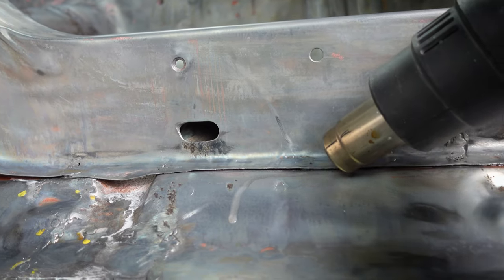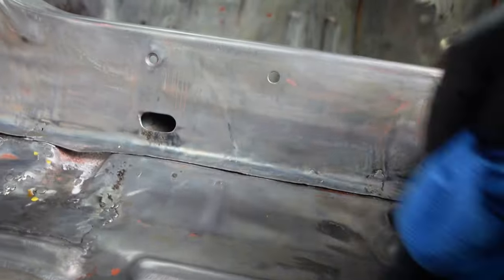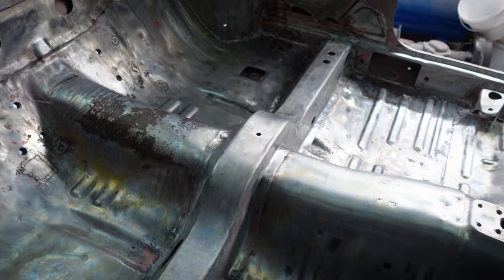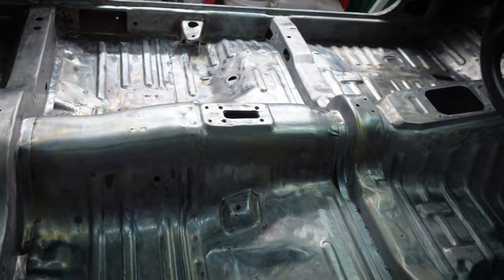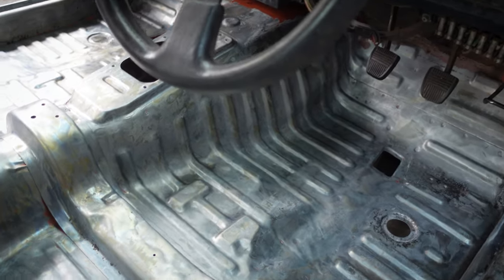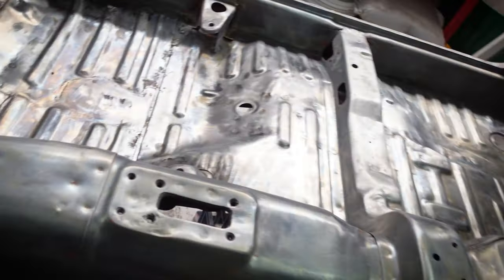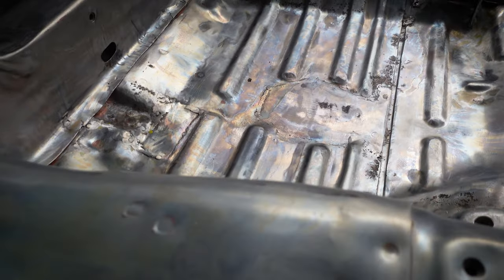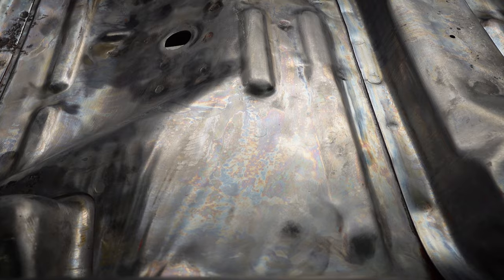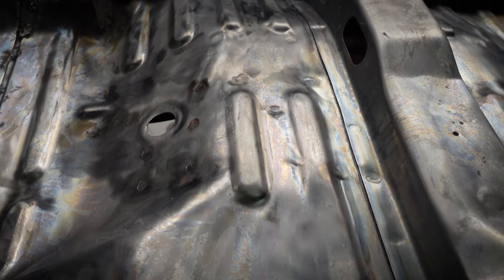And then this time I actually got smart and I used my heat gun to blow out all the remaining seams and dry everything up completely. After that I just left the whole thing to dry for a couple more hours just to be sure. The Rust Blast seemed pretty good, not only does it obviously neutralize the rust, but it also seemed to etch the surface a bit. So while there's still a bit of flash rust around the place and a really cool hologram effect on the coloring, it also felt like there was a really good surface that the rust sealer could bond to.